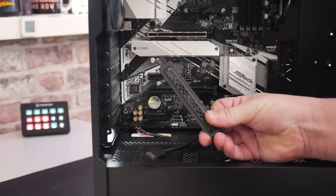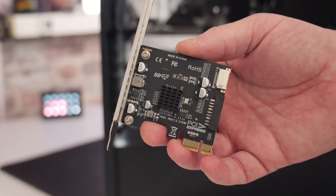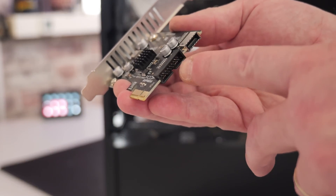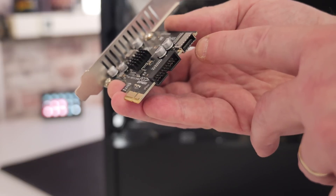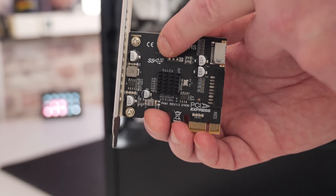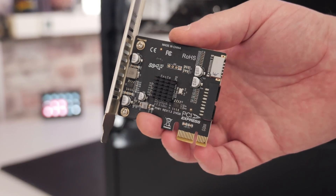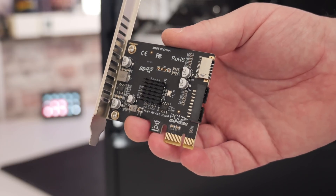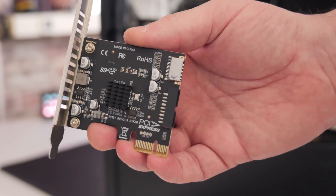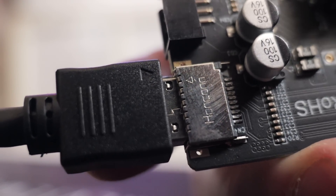This case has got removable PCI Express brackets. Potentially your case might have ones which you have to bend or wiggle to get out — either way, just make sure you've got a blank slot. Now we'll get our PCI Express card. You've got two ports — this one for the Type-A's and this one for the USB Type-C. There's also a small heatsink on there, which is beneficial if you're doing lots of data throughput. If you're not too sure what speed your card is, normally there'll be something printed on the card — this one says super speed 5G, so five gigabit per second. There should also be a little triangle to denote pin 1.